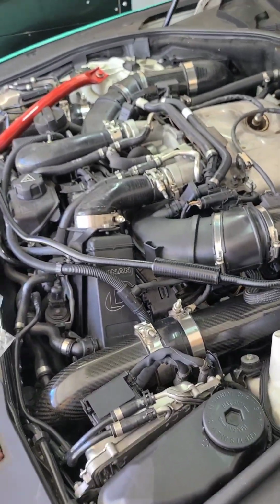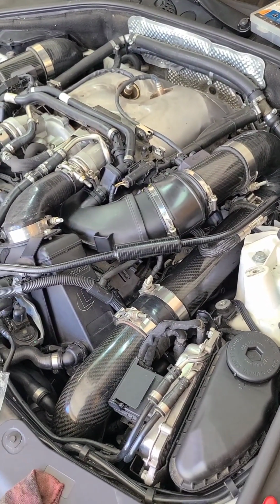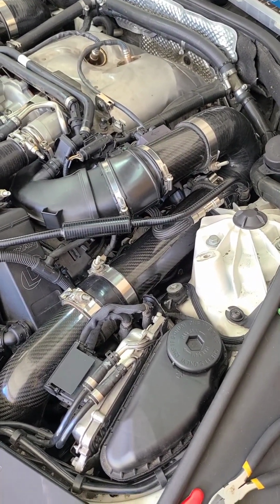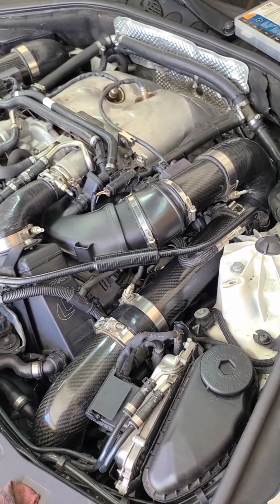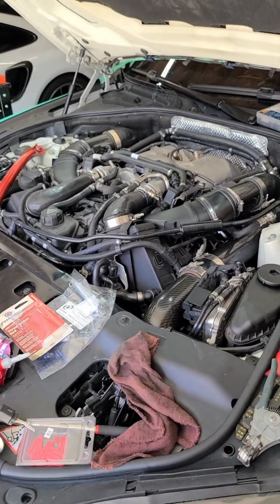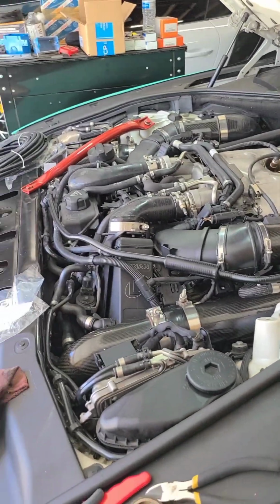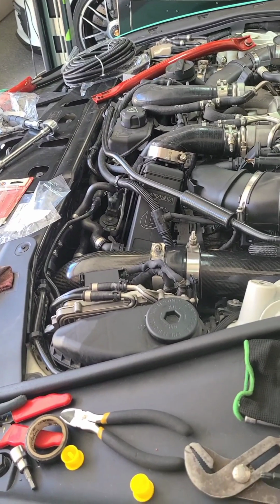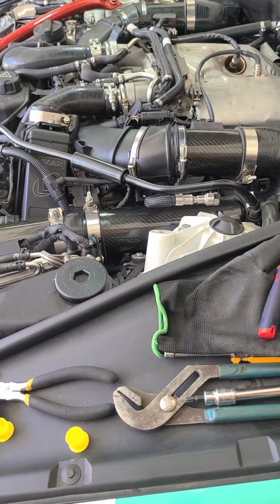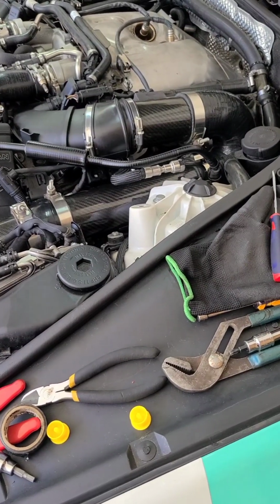So I'm going to do the other side probably another day. I might just loop it into one video. But once you see you got one side done, you basically know what to do with the other side. Like I said, there were other videos showing how to do the pump, but they were basically just replacing the factory original pump. So this video shows you a 650 N63, and you're upgrading the pump to an S63. So that's what I did. This is the F90 pump.